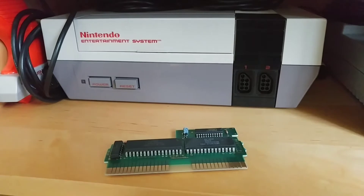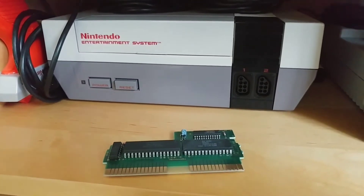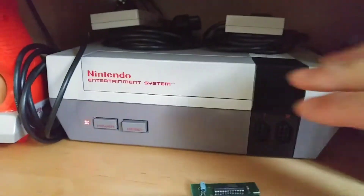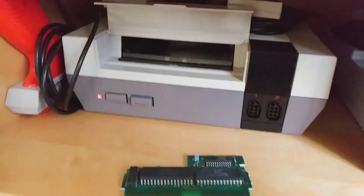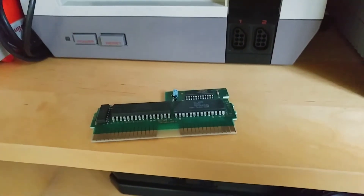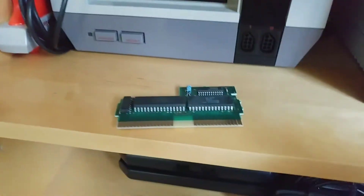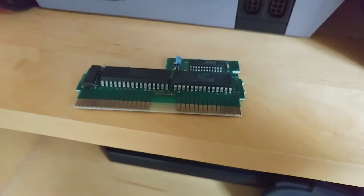For the last 30 years, this has been known as dirt. Why do I say dirt? Because it's from your games being dirty. You can also recreate the issue simply by turning on your NES console without a game in it, and you'll get the blinking red light, the flashing screen, and all the other crap associated with this simple issue. The reason is either your 72-pin connector is dirty, your game is dirty, or both.